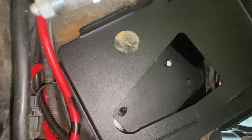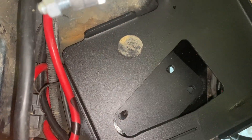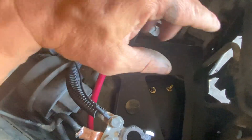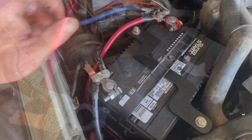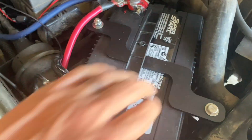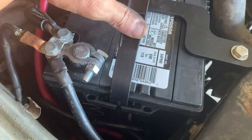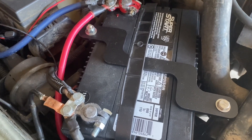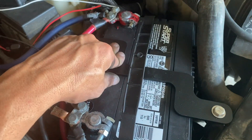Got the sensor back in and plugged in. Since this one bolt goes up, you have to insert this rod before you put the tray down. I had to drill out two of mine since they broke off — I'm just going to put a nut and lock washer on there with a bolt and reuse the first stud. Once you get it in, it's not going anywhere. Set the battery in, put the hold-down clamp on top, and finish bolting it up. This thing isn't going anywhere — it gives me a little more clearance between my radiator hose and battery than I originally had. Definitely check them out — Mountain Vista Fabrication, Brandon and his guys are awesome. Two for two on quality of parts. Highly recommended.